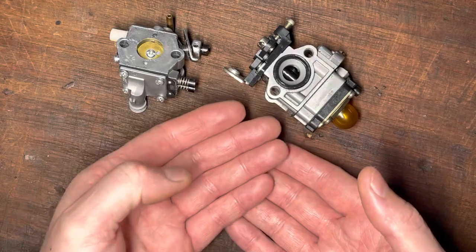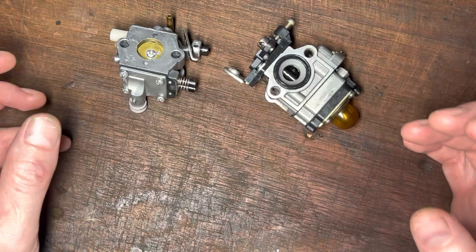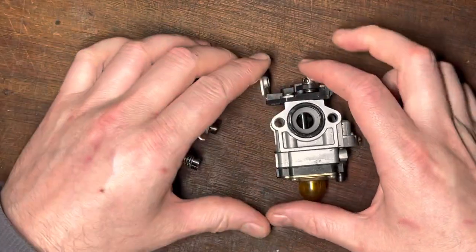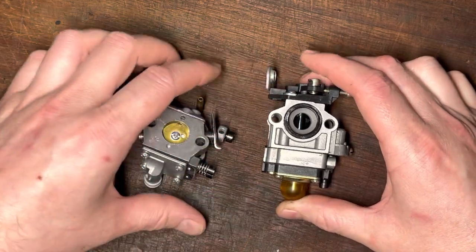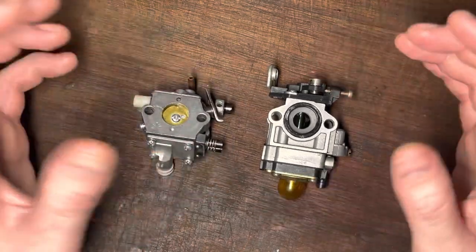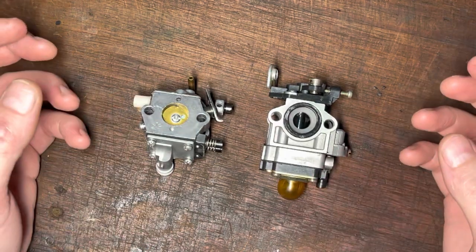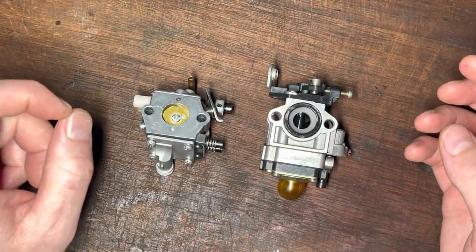When you let an engine idle and you pick it up, you disturb the fuel supply in those two main areas and the engine will change in RPM — that's very normal and it's not a lean symptom at all. Ignore it. Turning the saw, strimmer, or whatever on its side when idling, you're more than likely releasing that puddle of fuel. The same thing applies if you pick the engine up and hear the RPM change — that doesn't necessarily mean there is an issue.